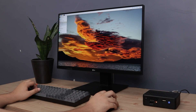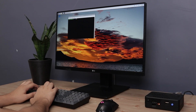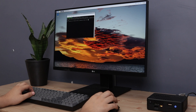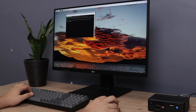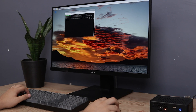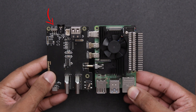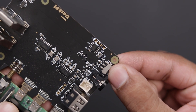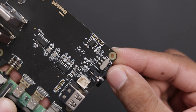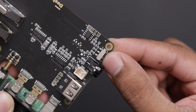Okay so as you can see I have set up everything and it's working just fine. You have to do some additional settings in the OS to use all the features that this case provides, like the front USB ports and the CPU fan. Now I will show you how to set up the CPU fan. There are two ways to do that. If you look on the mainboard there is a small switch for the CPU fan — if you set it to E, that is enabled, the fan will always turn on. If you disable it then you will need to set it up from the operating system.